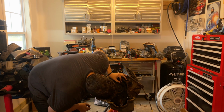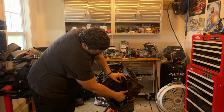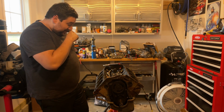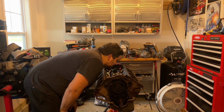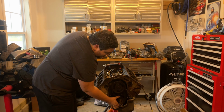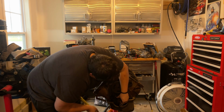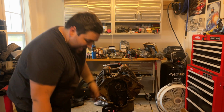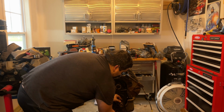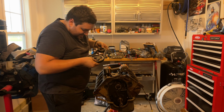I think that's a little bit more than ideal timing chain slop right there. So, good thing we have another timing set. It is a double roller. I don't know if those are like it from factory. So, I mean, that's maybe a plus. Always make sure you have two hands on your timing set. Yep. That hurts.